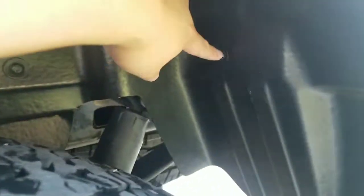So I want to practice on the driver's side before I actually shoot the video. The clip is in down there, we got our OEM screw right there, the two screws that go into the J hook there, and we got our Christmas tree fastener on the other side. Overall this was real easy to put in — when you push it up, it actually snaps into place. The key will be to put in these screws here first to align it and just hand tighten them. And then down here I'll actually show you a little trick for the Christmas tree.